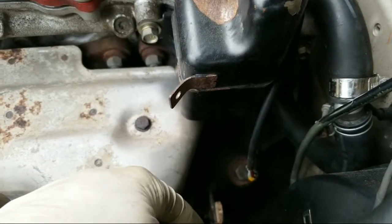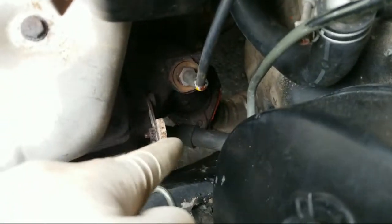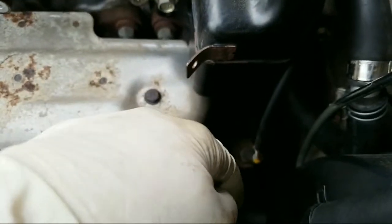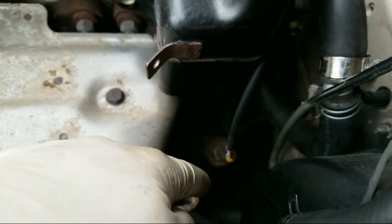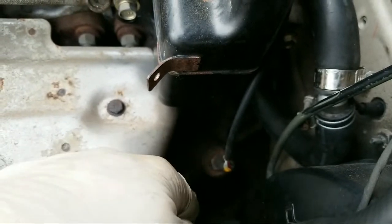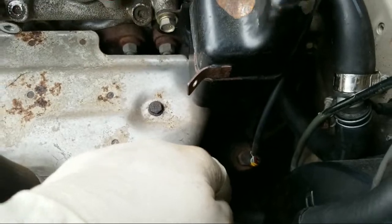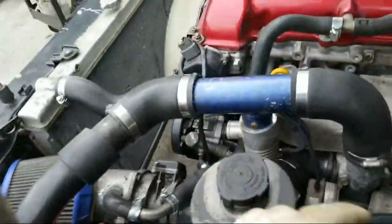Now, the steering shaft for the steering column, that one there, is going to be hidden in there. So disconnect that one before you put the engine in. I removed that pipe that I'm telling you about for the turbo elbow. Plug the hole and you should be good to go. Everything bolts in. Motor mounts bolt in, same position, everything goes well.